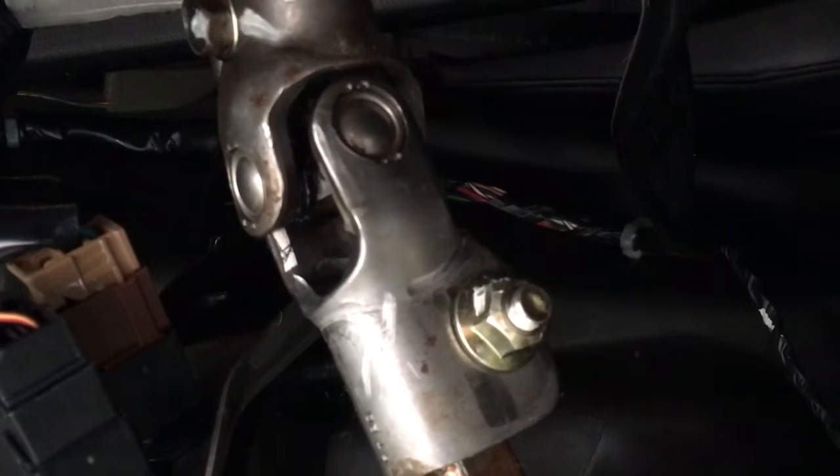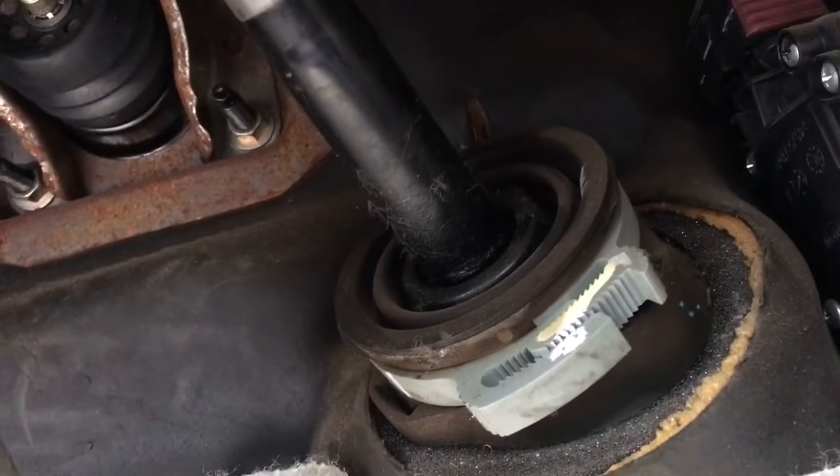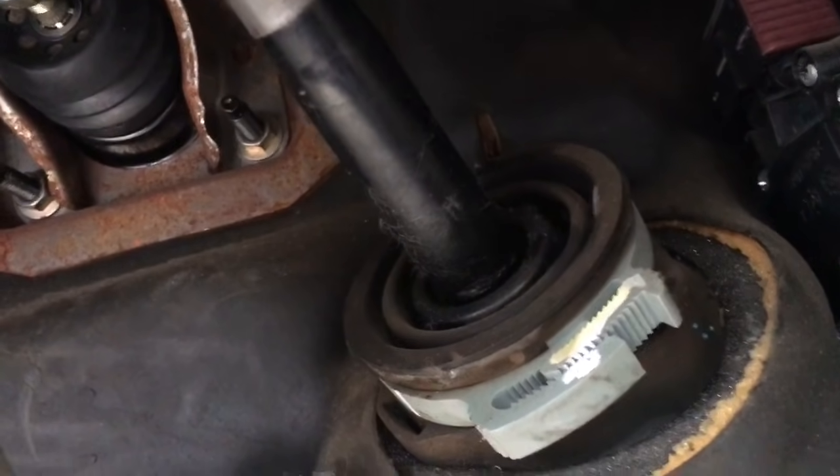You have to come under the car, down by the brake pedal. This is your steering — it's almost like a CV joint. Your steering goes through the joint and then into this shaft that goes through your firewall down by where your engine is. There's a nut right there — a 14 millimeter — and you can take that off and disconnect your steering from the shaft. This little piece here falls right out.